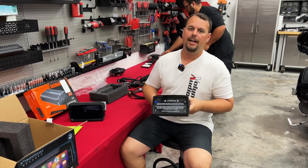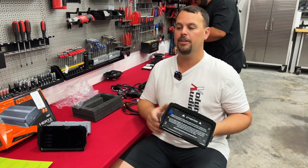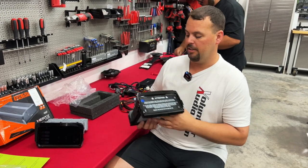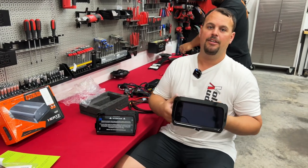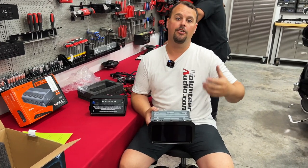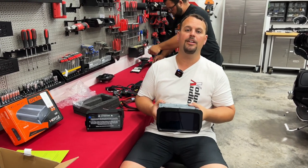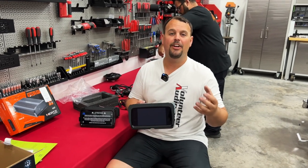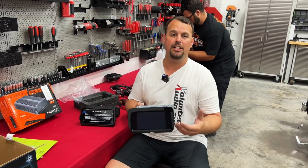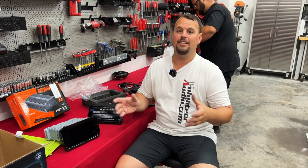So let's talk about radios. I have never, ever in the 25 years that I've been doing audio in vehicles — whether it be cars, trucks, boats, whatever — has the factory-installed equipment ever been as good as a quality aftermarket unit. This factory GTS radio is no different. To be able to get good sound out of it, we have to flash it — flash it to fix a terrible factory EQ, flash it to turn on rear speakers, flash it to make CarPlay work. So many things we have to do by computer just to make it a usable radio. But once we flash it so that it sounds good, we have very, very little sound control. The bass, if you turn it up, just distorts, clips your amp, sounds terrible. The treble has very little change as well — so the factory EQ, in my opinion, is not worth anything. Pretty much after you flash it, what you get is what you get.